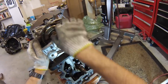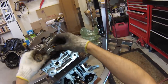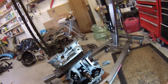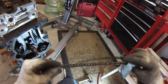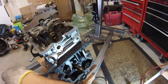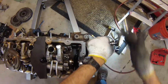Now that we have the tension off, I'll finish taking off the camshaft sprocket bolt, pull off the camshaft sprocket, and separate it from the chain. I'll drop it down, pull it off at the bottom, and take the chain out. You don't need to worry about front and back orientation because the gold links are only on the front side of the chain — when you put it back together, just make sure the gold links are on the outside. Next we need to remove the chain guides, which are behind plugs that have a 10mm Allen key socket. Behind the plugs there are 10mm bolts holding the guide rails in place — be very careful not to drop these bolts.